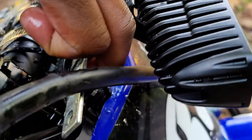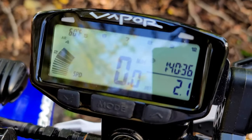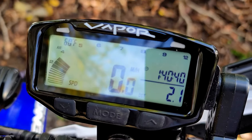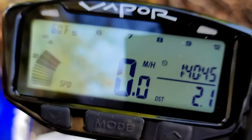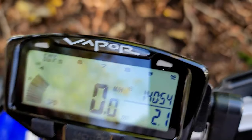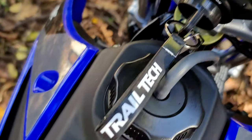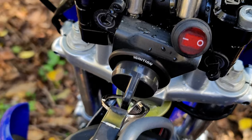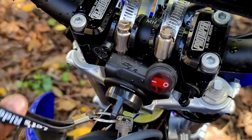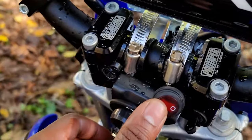Got it on — had to hold the choke open for a second. Yeah, the whole choke assembly is going to get removed and put down on the carburetor; it's doable but it's just irritating. There we go — you can see the Trail Tech reading the RPMs and the tach going nicely. It can also read outside temperature, but I didn't hook up the engine temperature sensor because the wire was too short. I also had to rewire my ignition down here, which is annoying, but almost every change I made to this bike required like three or four extra changes just to make it work.